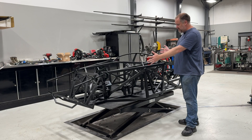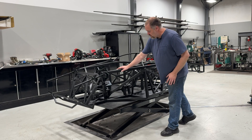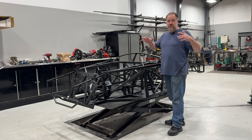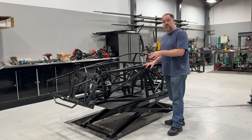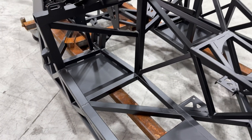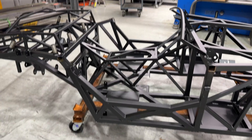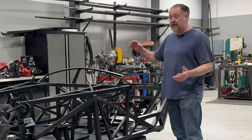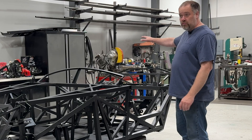The front is quite a bit stiffer — you see all this support up high, which really makes the whole thing twist less, and that makes a big difference in how we can tune the suspension. The floor is quite a bit lower, which gives you a lot more headroom in terms of where you sit relative to the windshield if you're a taller guy, and where you sit relative to the roll bars.